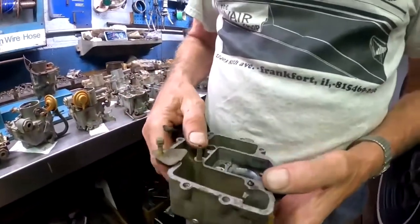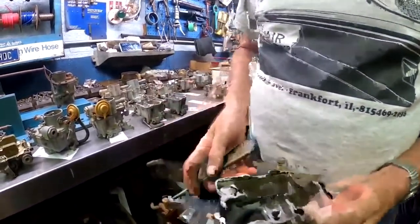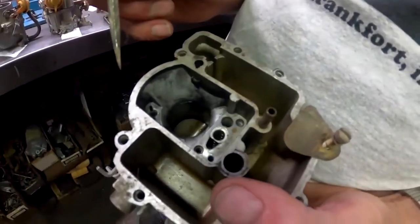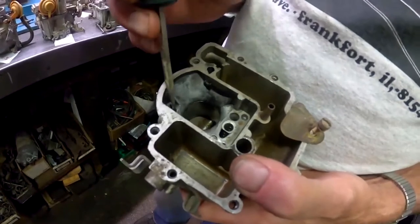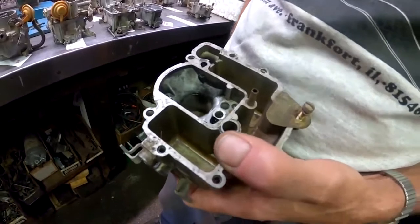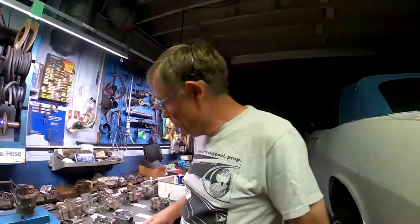They eliminated that feature. And now this is a 66 style carburetor, an early one. We know that because it's got both the power enrichment and the extra idle air bleed. They made the air bleed non-adjustable. Our other one had a nice screw where we could fiddle with it, but this one has a fixed idle air bleed. There's no screw there for us to turn. It's kind of pressed together and it has a little plastic piece on top to keep you from getting your screwdriver in there to try and turn anything. And that's kind of what the industry was doing. They were putting caps on the idle mixture screws and limiters so you can only turn them so much. And that's what they did on the Corvairs. So you could have an air injection carb with either one of these styles.